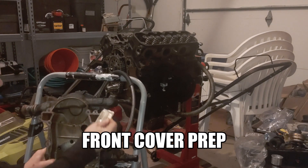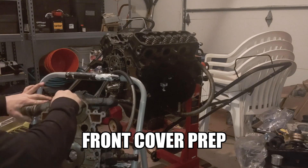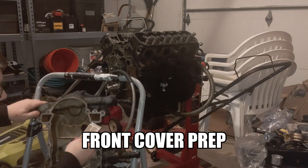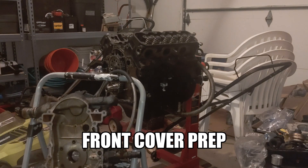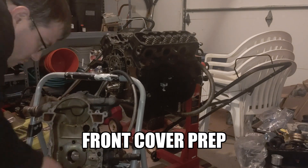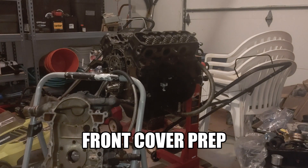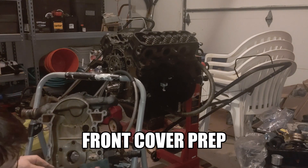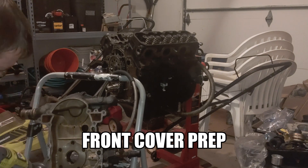I kept using the vacuum to eliminate anything staying behind after scraping, then I would start touching it up with a scotch-brite pad — cleaning off the gasket, getting the main large pieces left behind, then coming in with scotch-brite to get a better seal. That still wasn't making me happy enough, so I moved on to a scotch-brite drill pad where I carefully and lightly removed any remaining gasket material, being careful not to dig into the surface, cause warping, or make the gasket have to fill more area than necessary.